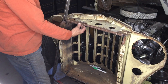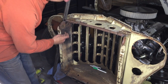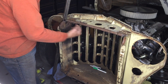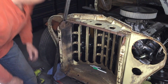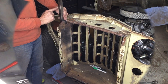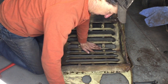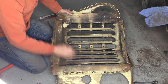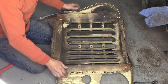I've got this top edge all cleaned up the way I want it - I've got a nice bend to it. There's a little welding here and there that I'm going to have to do in some spots. Now I want to bend this - I've given myself about three quarters of an inch offset because the radiator actually sticks out on the top here. I marked where I want it to bend and then I'll clamp this on, bend it around this rod, clamp a tube on the back side, and just bend it by hand, then use the hammer to tap along that edge. That's working great - this one ended up breaking all the spot welds a little, so I'm going to have to go back and reinforce it and weld it into place because with the weight of the radiator things will break loose.